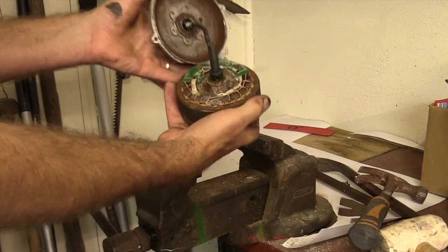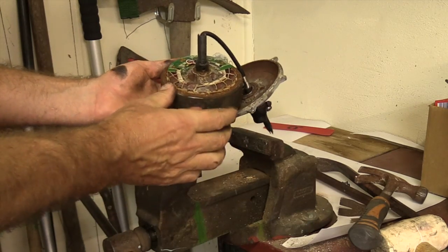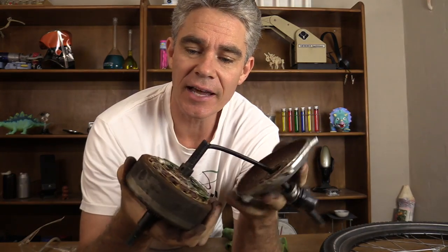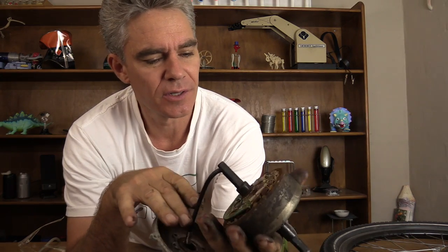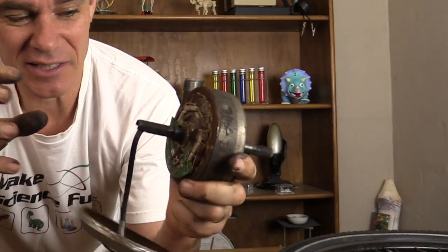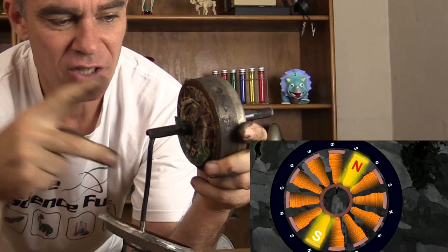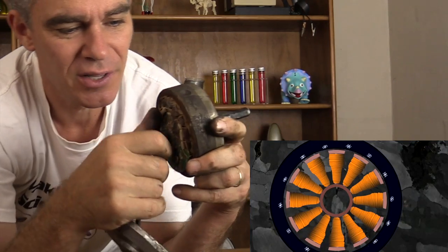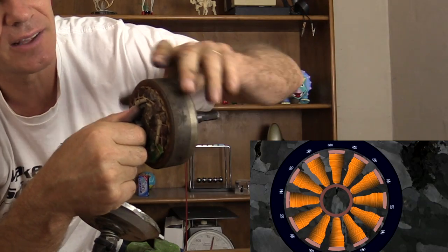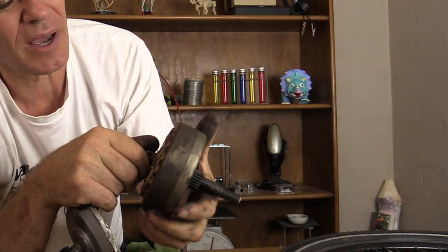Ta-da! And there it is. Even the inside of the motor is old and corroded. But basically, to make this motor work, you have to send signals to each opposite pair of coils. Turns them on - each pair of coils is fired up and the outside rotor is pushed on by the rotating magnetic field. Pretty straightforward, pretty basic.